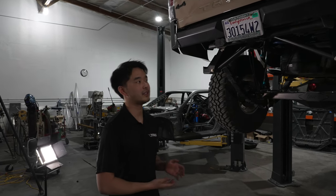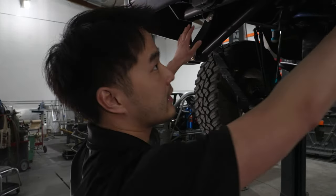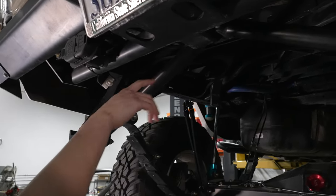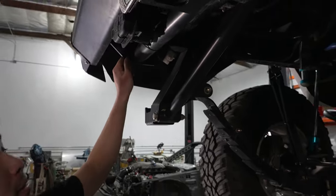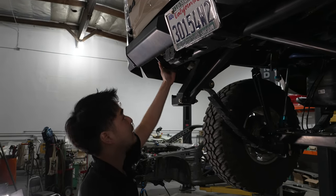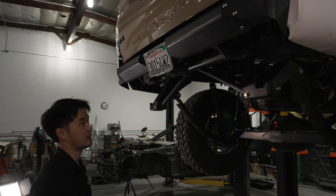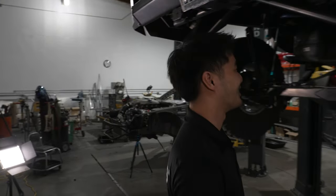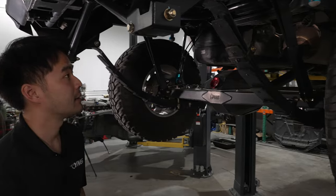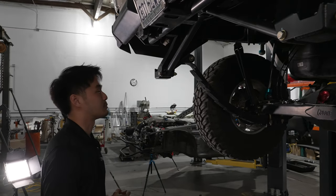With the truck in the air, let's revisit the rear bumper structure. The two-inch 120-wall chromoly tube braces the hitch which is sunk in behind the quarter-inch chromoly plate. The assembly attaches on two planes with three-quarter-inch 12-point through bolts — very strong so we can actually tow with it. Moving to the leaf pack, we replaced the standard hardware with 12-point bolts throughout. We also have a chromoly structure bracing the hangers — two-inch 120-wall tube to inch-and-a-half 120 tubing, triangulating into the chassis.